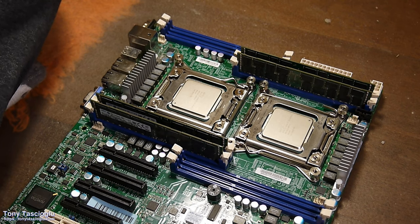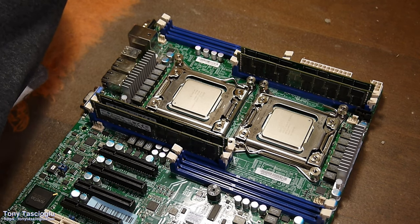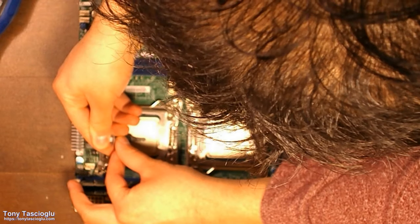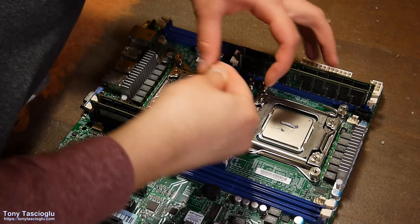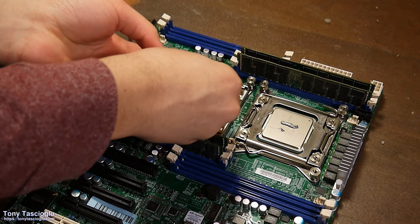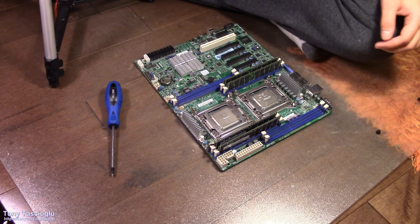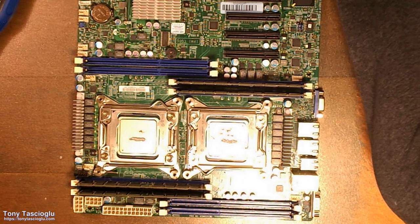All right, next up, let's put some thermal paste so we can install the heat sinks. So I'm going to grab the thermal paste that came with one of our coolers. Hopefully this hasn't completely dried out by now. Hope that there's some left. Not very even because we're at the end of this puny tube of thermal compound. I know for a fact that this left one needs it more, the right one doesn't have as hard of a job. I do have two more rolls of these that I should have brought up, but that'll be for the next time I uninstall and reinstall the heat sinks.